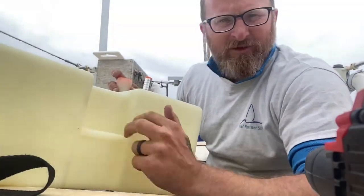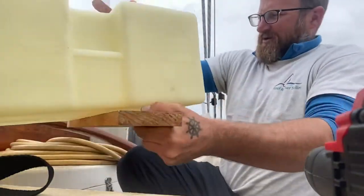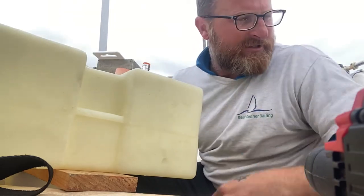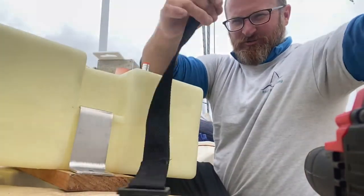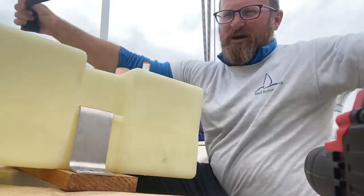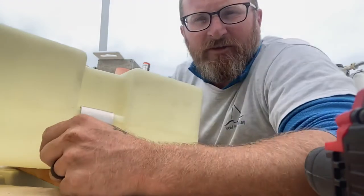The tank came with little lash-down points, so I bought aluminum brackets. I'm going to create basically a strap board that will bolt down into the base of that box I just cut into and lash it down. For the back side, which is a lot harder to reach with screws and a screwdriver, I'm going to lash it down with just an old battery box strap, and I'll use the same thing with a half-inch piece of furring strip — screw down the strap, lash it over the top, and it should hold it down nice and tight.